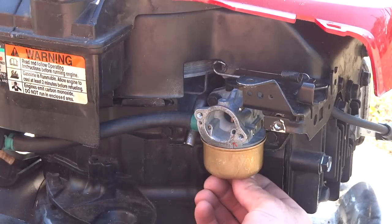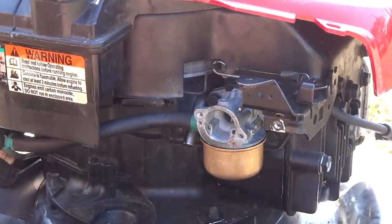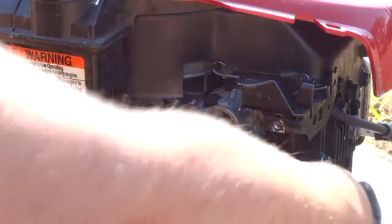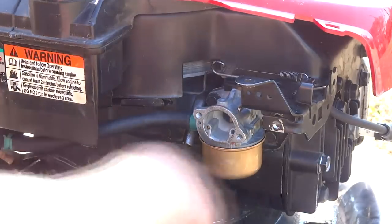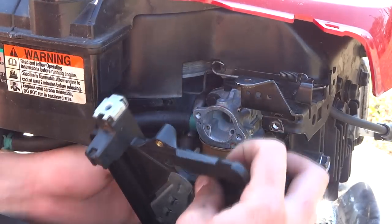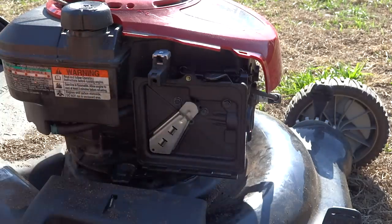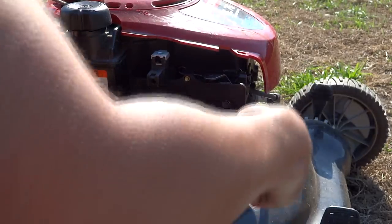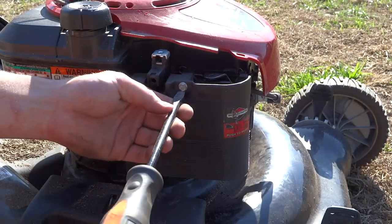I always like to bleed them first. I just went ahead and put the line on, so now we're going to loosen it. I want to get the air out of the system, so I just loosen the nut and as soon as it starts dripping, there we go — we got some filling up. We'll tighten it back up. Let's put our filter cover back on, put the three 5/16th bolts in. Make sure you put this hose back on first — slide the hose on there. Go ahead and put your filter back on. You're just going to slide the filter right in there, put your three brackets back in there, push it forward, and tighten the 5/16th bolt with either a flat head or a 5/16th socket.